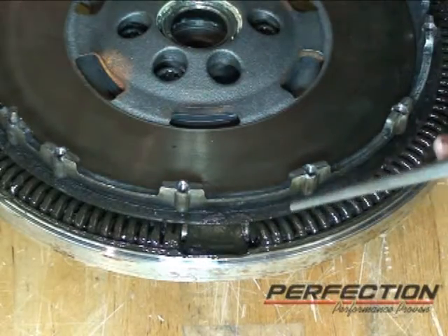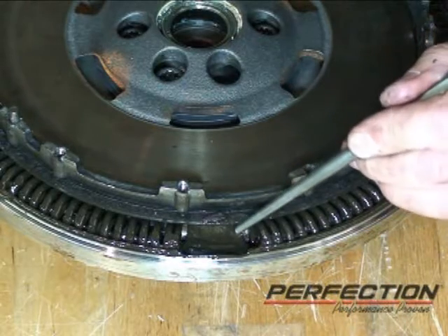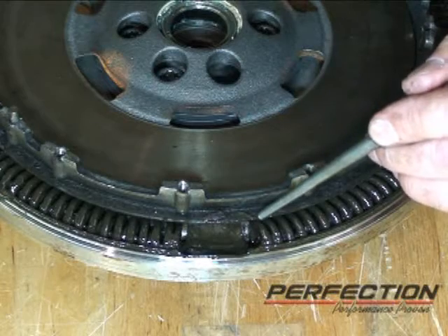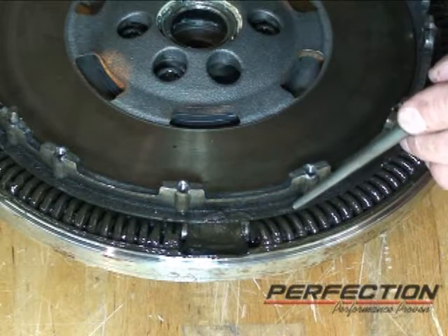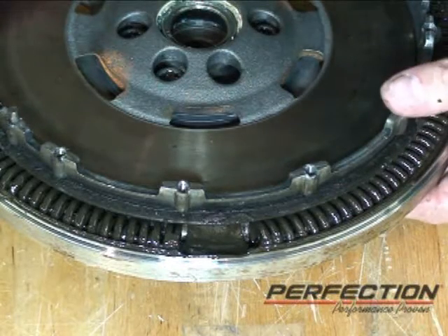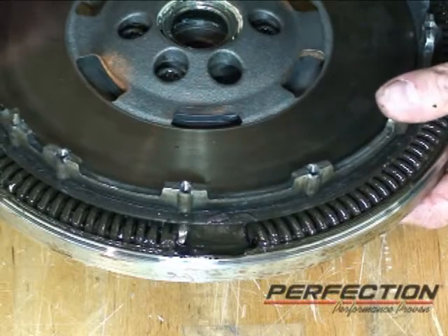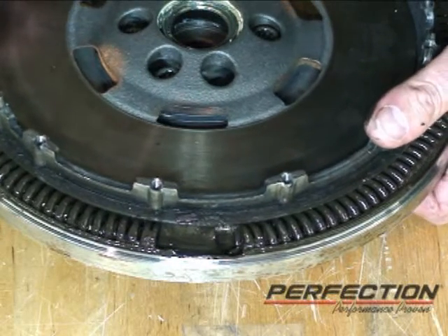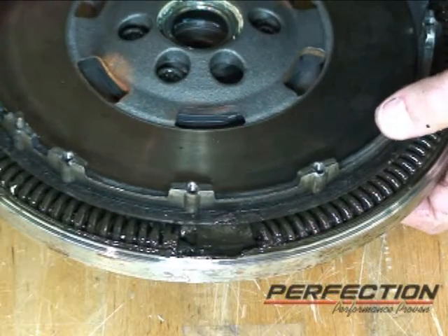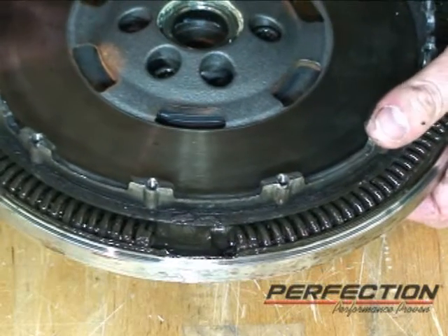I used a lathe and cut the flywheel open — this is the ring gear section I cut off, and you can see the grease, along with the clutch dust and grease debris we were concerned about. The grease appears to be a lubricant for the long damper springs inside. This piece rubs against the piece I cut off, and there's a seal action right out here. When I rotate the secondary, you can see it start to bump and compress the springs — this is the torsion damper function inside this dual mass flywheel. This particular flywheel only has about 26,000 miles on it.